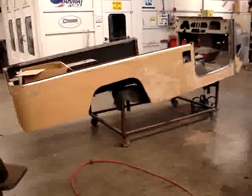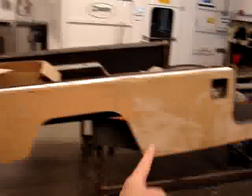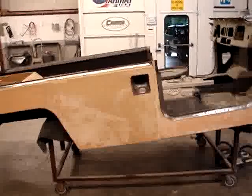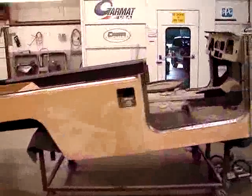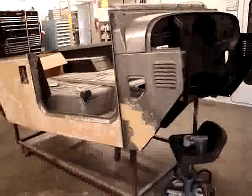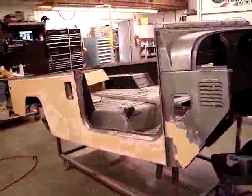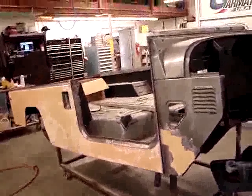We're doing a lot of body work. This body work is a lot of this stuff that you see here. Putting in a lot of this Bondo body work, sanding, taking it down in order to make the panel straight. The welding and the recreation of the quarter panels and floors, supports and things of that nature take its toll from a warpage standpoint. It tends to warp things, and that's what's going on here. But that's typical in any type of major restoration of any vehicle. And so what we're doing is just smoothing it out.